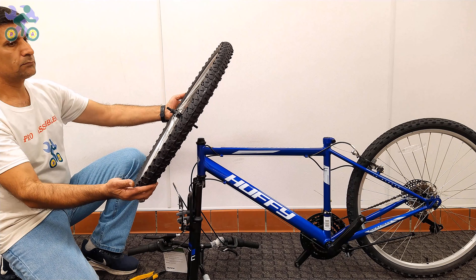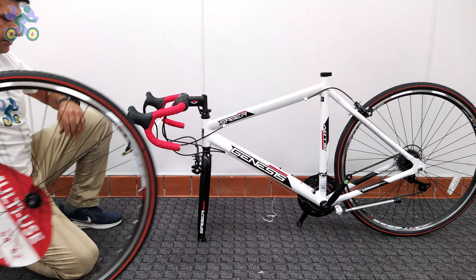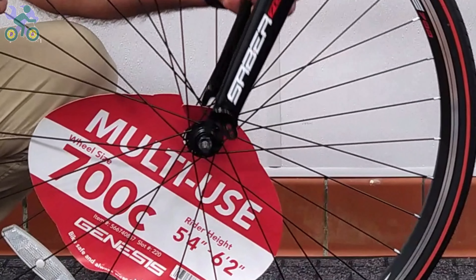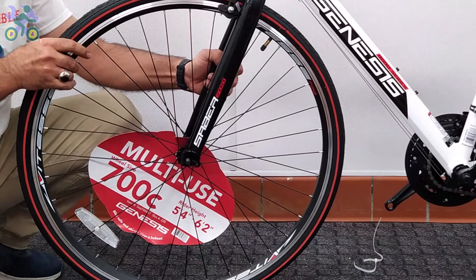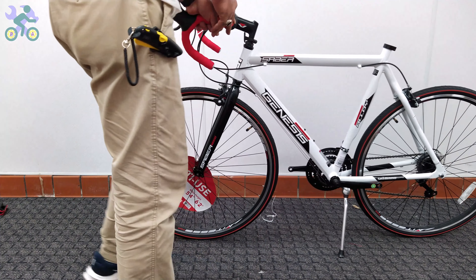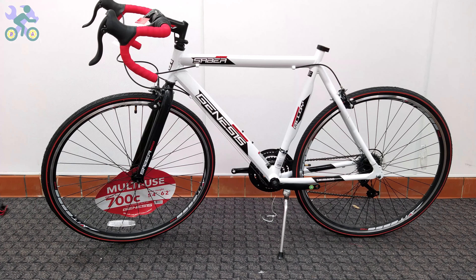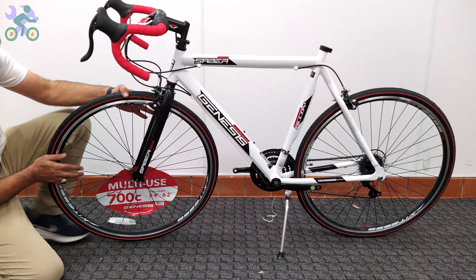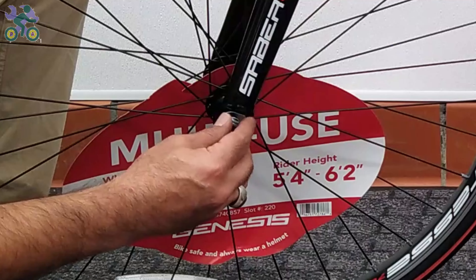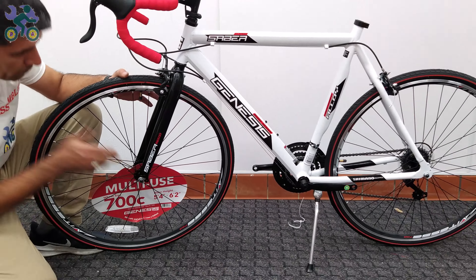Check the tire and if available find the direction of rotation marked on the tire. Lift the bike frame and place the wheel axle in the fork, then open the kickstand — you will notice that the bike is stable, although it's best to always keep one hand on the bike just to be sure. If the fork was bent and you couldn't put the tire in the fork, I've made a video and put the link in the description below on how to fix it. There is a hole at the end of the fork; insert the wheel retainer into the hole and tighten the head nut by hand. In limited models, only washers are used for the wheel retainers. Repeat the same process on the other side.